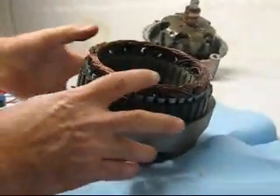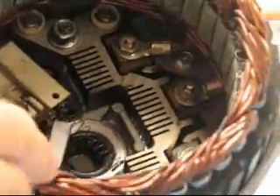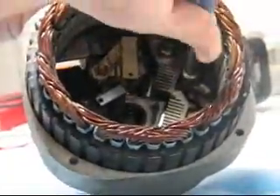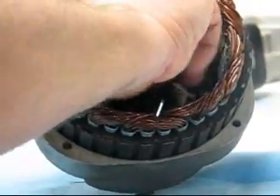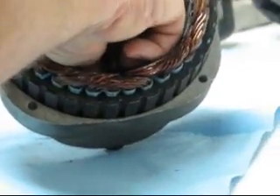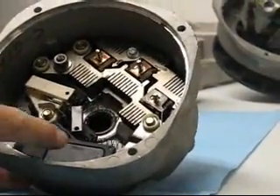We're going to focus on the rear case. We have the rear case with the stator in it, and if we look down inside we have the three connections where the stator connects. We have the brush holder and the voltage regulator and the bridge rectifier. The first thing we'll do is take the stator out — take the 11/32 socket and spin those nuts out. We have three of those. Give a tap on that case and now the stator is away from the rear assembly. You can see it much better now — we have the fin bridge rectifier, the brush holder assembly, and the voltage regulator.